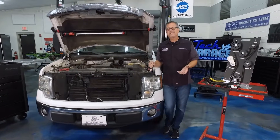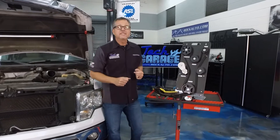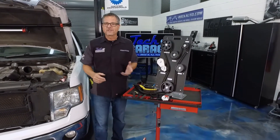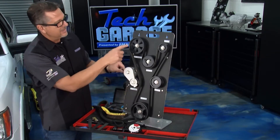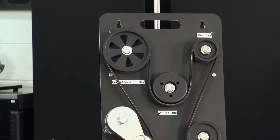What is a serpentine belt and what does it do? Here's serpentine belt reminder 101. It drives all of our accessories on the car. This is the harmonic balancer, then the serpentine comes around and drives power steering, water pump, alternator — could drive air conditioning.